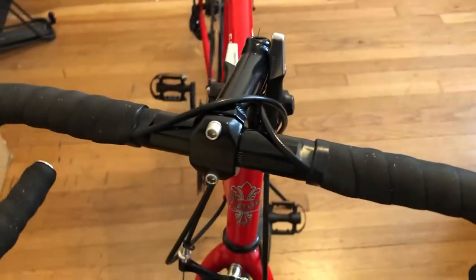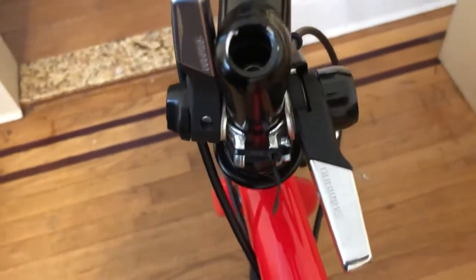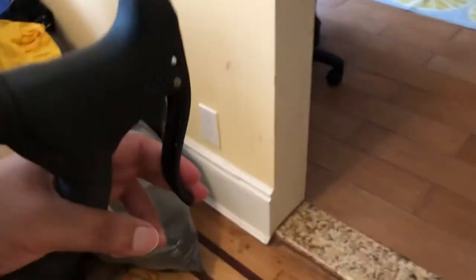If you want a stiff bike, kindly go for the Carbon or the Reynolds 853, which Bikes Direct also has to offer. I would also tighten the screws around the stem friction shifters as they tend to loosen up. If you do lose the screw or aren't able to screw it back, then you can use a zip tie like I have, which creates a secure lock for shifting.